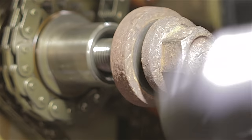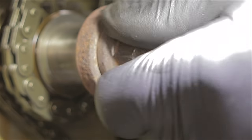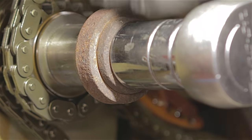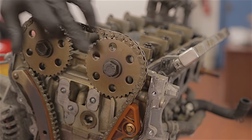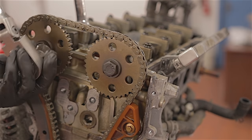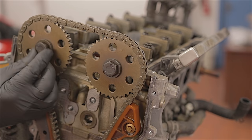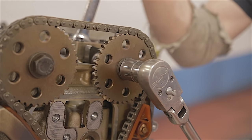At this point, I suggest we put the crankshaft bolt back in and just screw it in finger tight — we can nip it up a little bit — for when we want to spin the engine over. We need to loosen these two bolts on the cam sprockets. There's like a 23mm spanner size on the camshaft, so you can actually hold the camshafts while you undo these bolts. That actually wasn't tight at all — that's nice and loose now. I'll loosen this one as well.